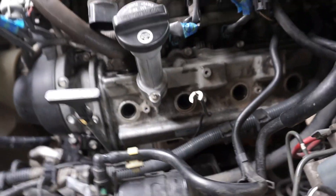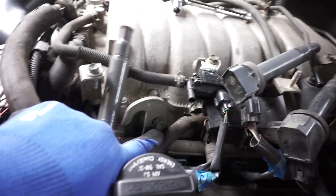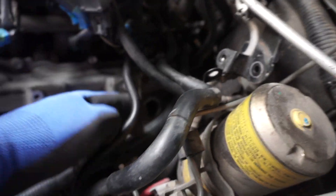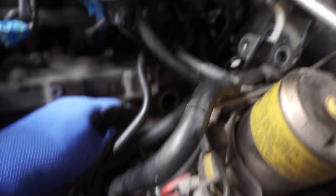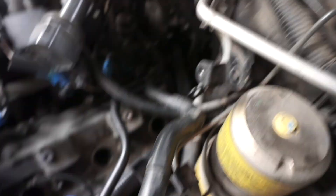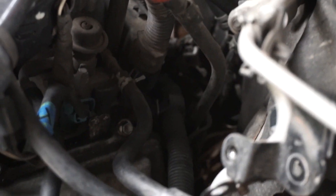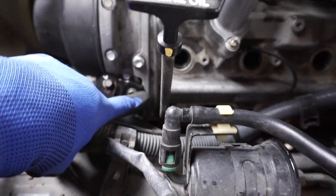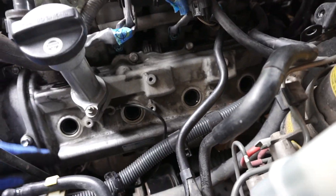Just a quick recap: we went ahead and disconnected the ground wire, removed all these connectors, removed that bracket so I could move this hose and get to that back plug. So we're pretty much good here. The only issue might be the harness — we might be able to remove it from the clip. Next is removing this one to give us some space from the valve cover, and the PCV pipe. Then we should be able to unbolt each individual bolt — should be ten total.